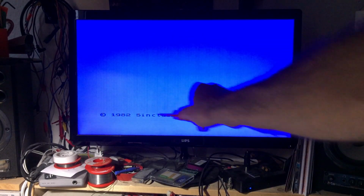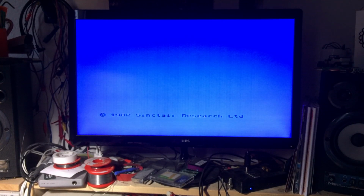And that's approximately how it looks in reality. It's really blue, and it seems to work, but the picture color is off. So let me investigate what that might be. I would guess it's one of the little transistors on there. I hope it's nothing, but yeah, reseating the RAM and all the chips at least fixed the flicker we had. So now it's pretty stable and looks pretty close, but not perfect.